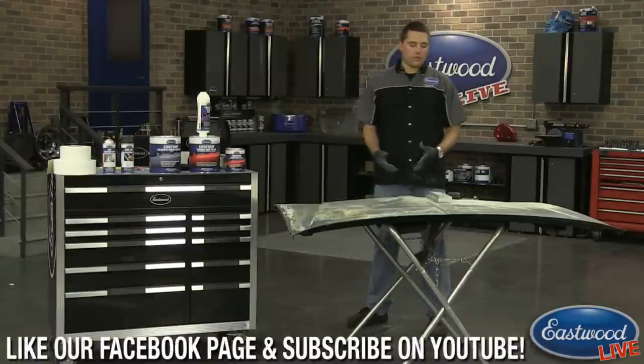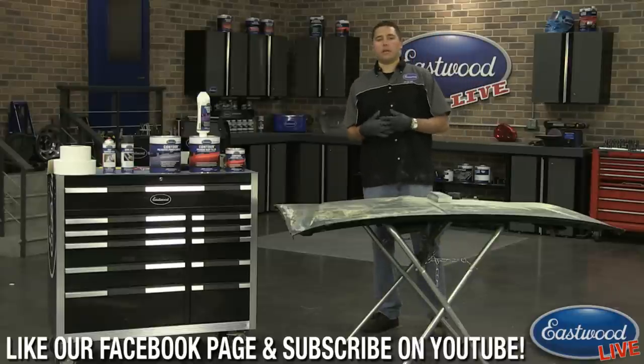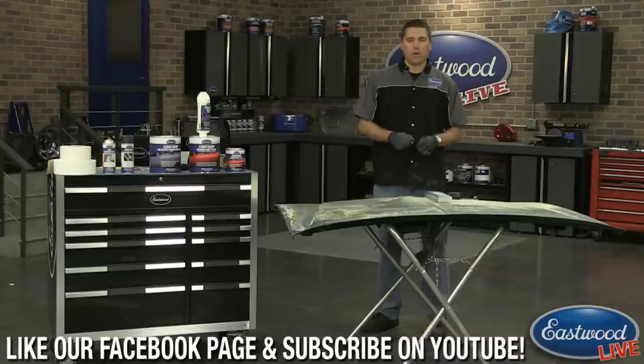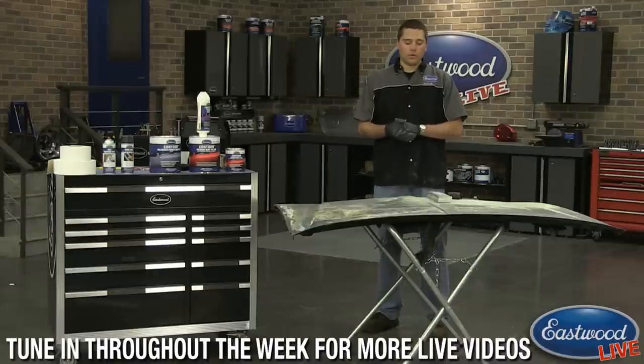A lot of times with encapsulator, we can do body filler over top of it. I personally try to keep it to a minimum, just a skim coat, as it is a non-catalyzed product. So frames, stuff like that, is where you use it a lot.